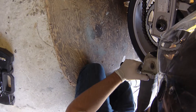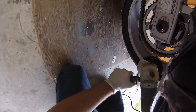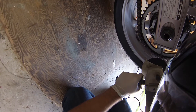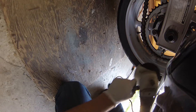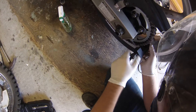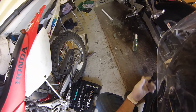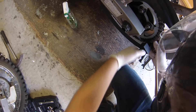I'm just going to flatten one of these pins — I'm going to use this one right here. Well, that was done quick. There we go — that's pretty much flat. So this hole in the chain breaker tool is for the back of the rivet to go into. You want to position it something like this, so you've got that link lined up, and then crank this down onto it like so.